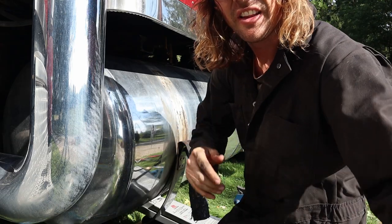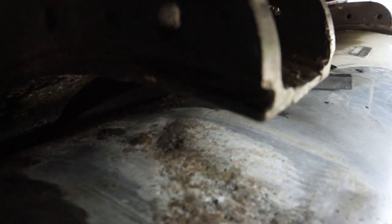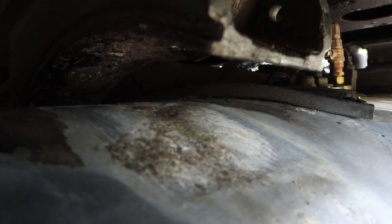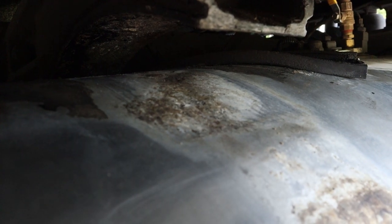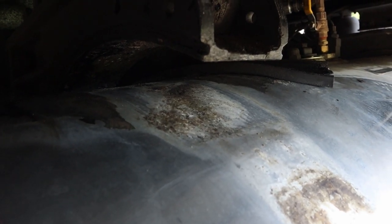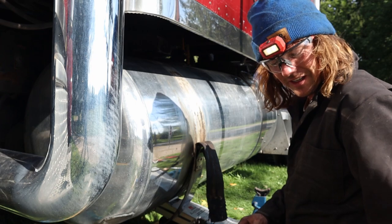I'm looking on top of the tank and there's a whole bunch of pitting — maybe one of those is leaking. It's hard to see on the camera, but the top of the tank has a whole lot of pitting inside. I think we just JB Weld the whole patch area — we'll clean it up, JB Weld it, and hope for the best, because I can't see anything obviously wrong along the whole stretch. I think that pitting up there is our issue. It'd be really nice if the sun weren't reflecting off the tank and blinding my eyes while I'm trying to find the leak.